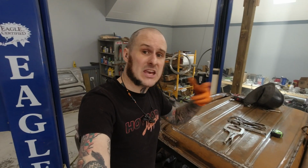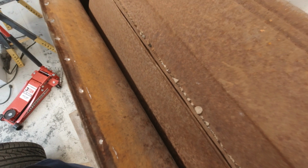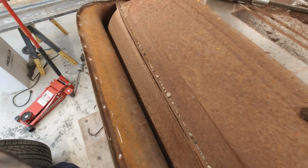Reinforcing areas like that, making sure that those joints where they're coming together are strong with good spot welds in there, that's how you get the vehicle to not creak and rattle going down the road. These are the areas that are going to give and move against each other as a vehicle drives that cause those squeaks and rattles that are so known in a lot of classic cars. We can reinforce that by methods like this and knock down on that noise ever occurring. I always attack a vehicle with the mindset that I want it to be better than it was when I got to it, if not better than it was when it rolled out of the factory.